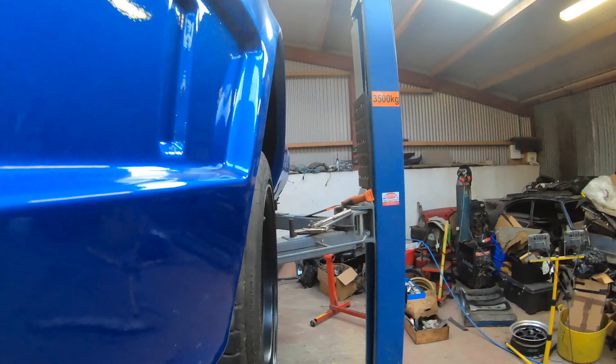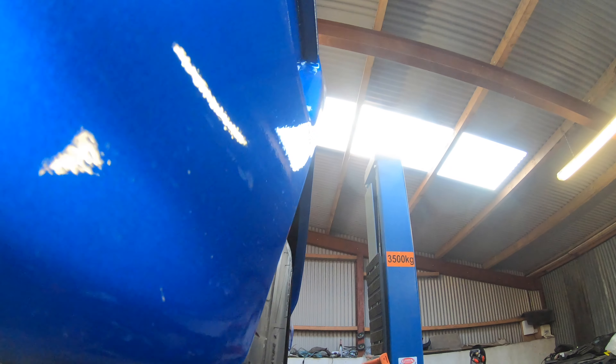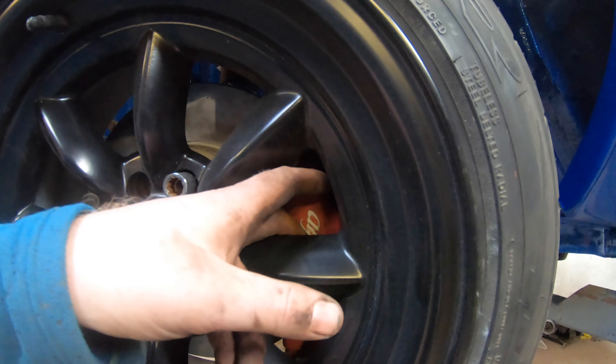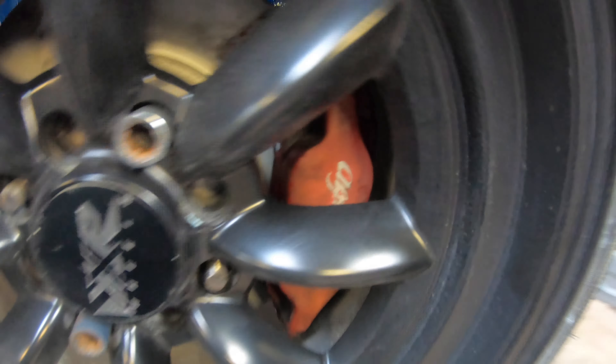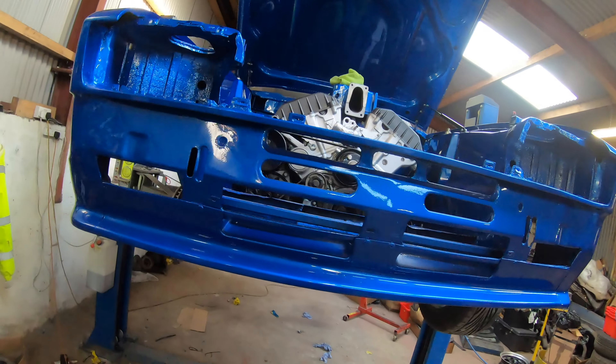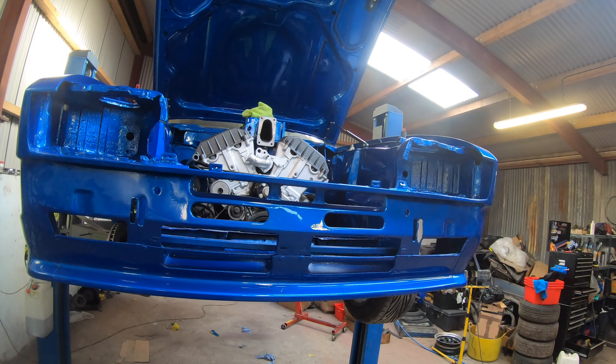Spacers-wise, I don't know what to do at the front. It's not obviously sitting down level yet, but I think it should be okay. That's a 15mm spacer on there at the front — I might be able to get away without it. If I get away without it, the wheels still fit with the brakes on, thankfully. So next up, I'm going to start to lower this car down and we'll start talking about what I'm going to do next with the engine.